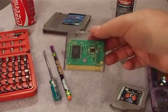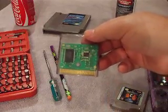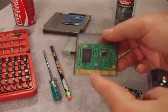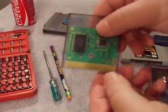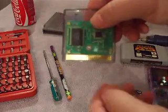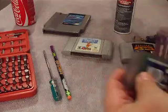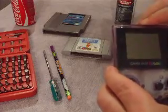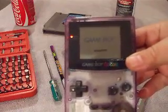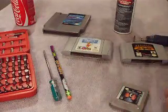It's a slide down, pop off. Once you take the cover off, you're going to see the circuit board. This is what I meant about the chips — you can damage these if you're rubbing them on a rug or if you walk across the room and touch it. One little static discharge and this puppy is gone for good. This is what I'm concerned with: these teeth, the contacts. There's some green corrosion on them, and from years of the game going in and out of the cartridge there are some scratches. I'm going to put the cover back on, pop the cartridge in, and turn it on — you can see it comes up and says Game Boy, and that's pretty much all it's going to do. So I'll take the game out and pop the cartridge out.